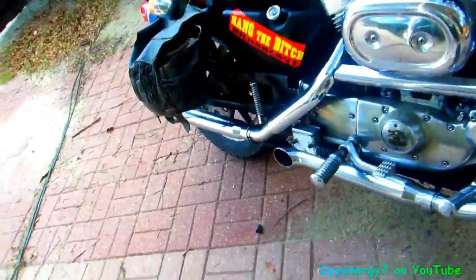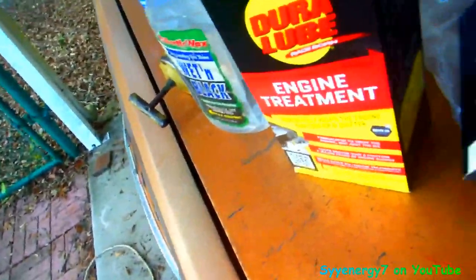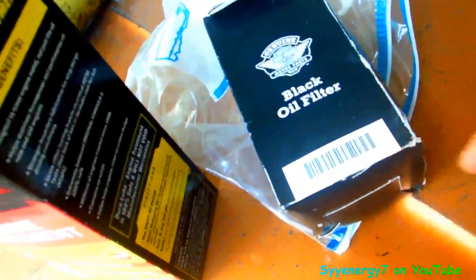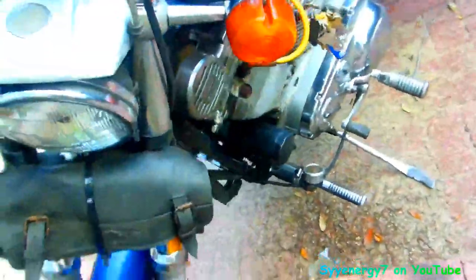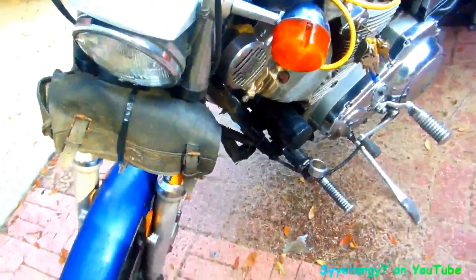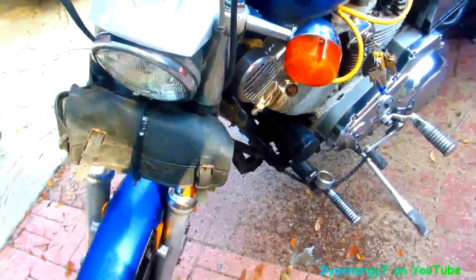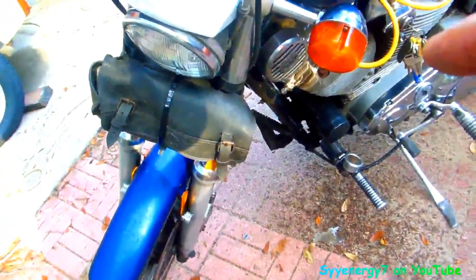The filter I use — a black filter's fine. It sticks out a little bit. The part number is 63812-90. It's actually for the Dyna-Glide, not really for the Sportster. Some people don't like it because it sticks out. You can get a chrome one, but either way they do the same thing. It's got more oil capacity, which makes up for keeping the oil not quite at the full level — so it's got the same amount of oil between the extra big filter and the oil cooler in the front.